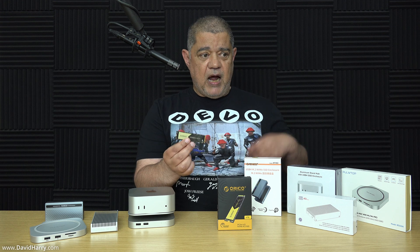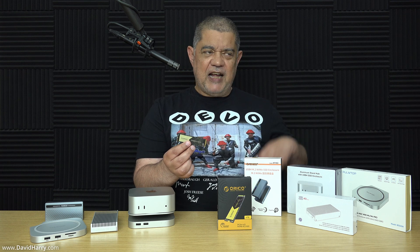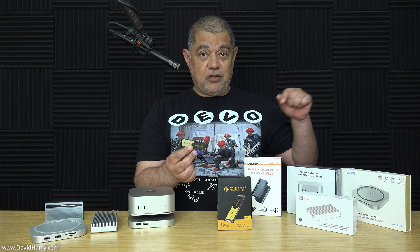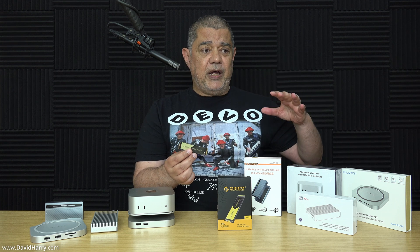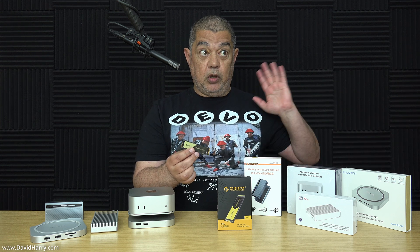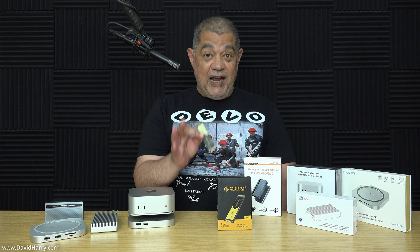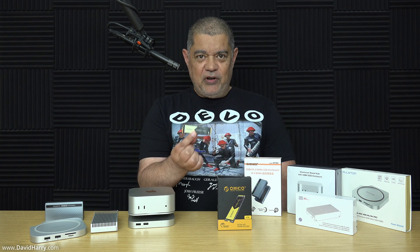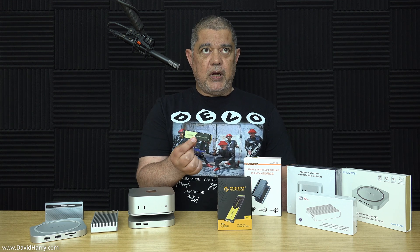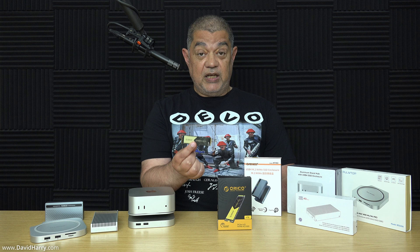That is massively surprising. I've had many 4TB SSDs, and even one of the supposedly best ones — the Samsung 990 Pro — is definitely a really good SSD as long as it's being cooled properly and has the correct firmware, because that drive is notorious for dodgy firmware that aged it far too quickly in terms of terabytes written. Even with correct firmware it still runs really hot. The point is this Orico has way more SLC cache than the 990 Pro at 4TB.